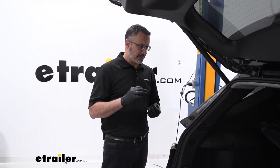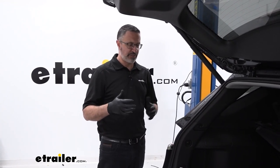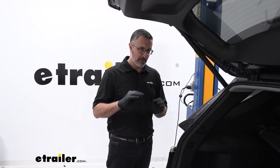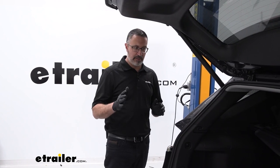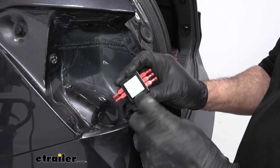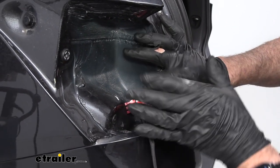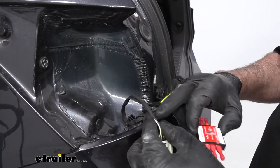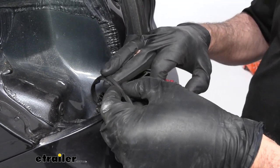We went ahead and tapped into the tail light circuit instead. We actually contacted Roadmaster directly and this is what's going to work for the Chevy Equinox with variable voltage tail lights. So instead of the brake circuit on the car, we're using the tail light circuit and that will do all of the functions that we need when this is being flat towed. Something to keep in mind: our diodes are going to have double stick tape on the back and they're going to need to be installed down and away from the tail light housing when it goes back on. To gain access, we'll peel back some of this protective loom from the factory and tie in back here.